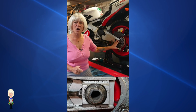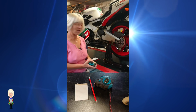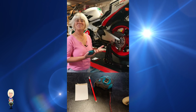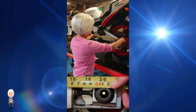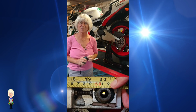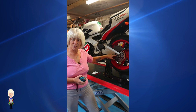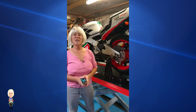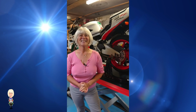Hello and welcome to Biker Stuff Shorts. Are you sure your back wheel is correctly aligned? Let's find out. These markers are only guides and may not be accurate, so let me show you a better way to get it right. You'll need a tape measure and probably a pen and pad. Measure from the centre of the swing arm pivot to the centre of the rear axle. Note it down, then do the other side. To correct any difference, loosen the axle nut, loosen the adjuster lock nut, and move the adjusters until both sides are the same. Of course, make sure your chain slack is still correct. Tighten your axle nut, tighten the adjuster lock nut, and you're finished. Thank you for watching. See you next time.